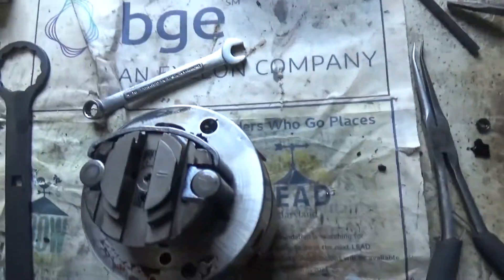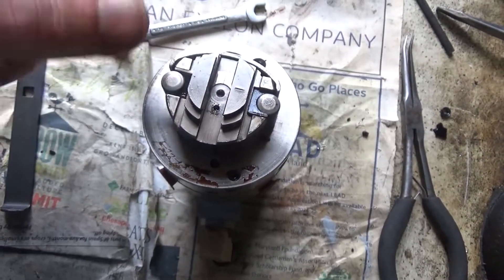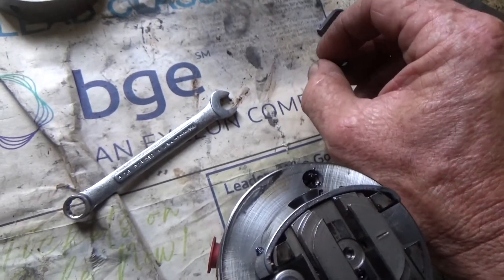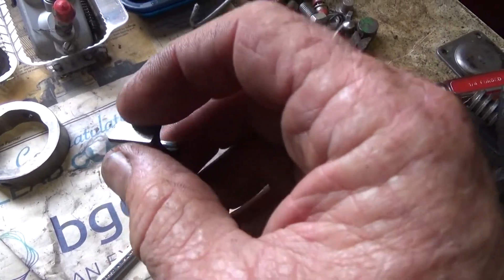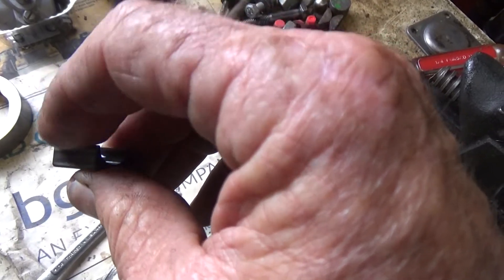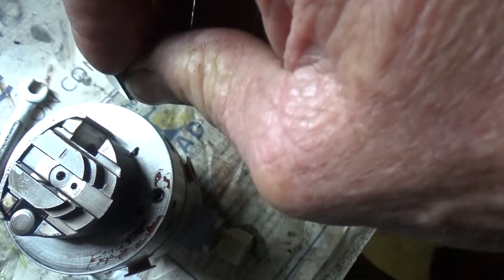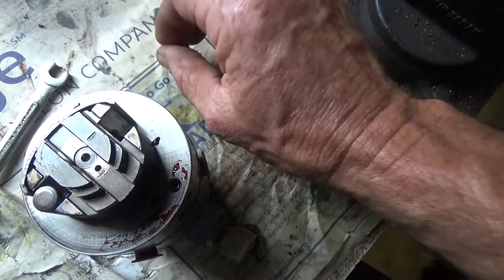Okay, you win — I knew you wanted me to tell you some little tricks to get a little bit more out of it. But you'd have to take your pump apart to do what I'm going to show you. If you take this leaf spring out, you can grind this edge thinner — that will allow these rollers to move farther. You can take that roller out and grind the edge down, I don't know, 15 thousandths, maybe a little more — 20 thousandths. Not sure what you can get away with, but that will allow it to come out even a little farther before it contacts that edge of the leaf spring. Just a couple little tricks.